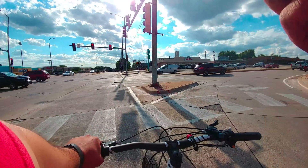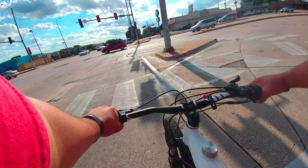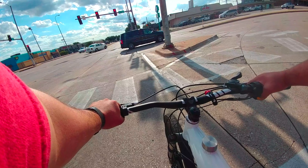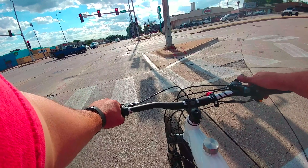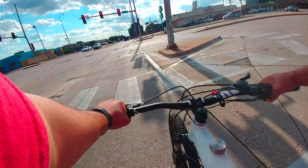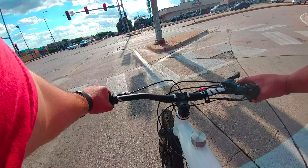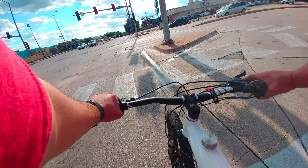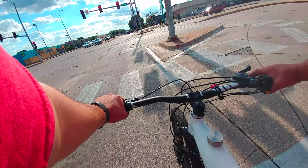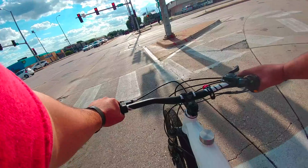As I mentioned in the video before, I did just increase the gear ratio by 10%. So it goes up hills in first and second — I got into third, but it's not great for straight up alpine hill climbing. It's good for top speed, but you can also buy different gears to lower or raise your gear ratio. If you live in an area with lots of hills, you can really make it an alpine hill climber. With a different combination of gears and jack shaft gears, you can really tune these bikes for the acceleration and speed you need.